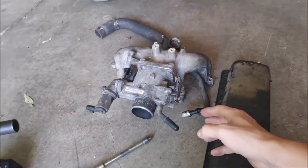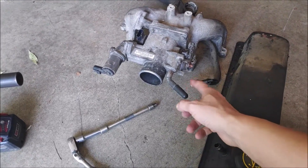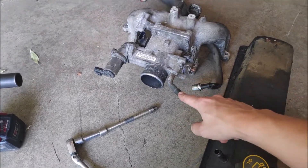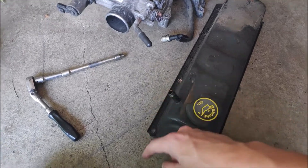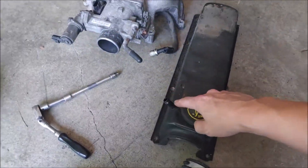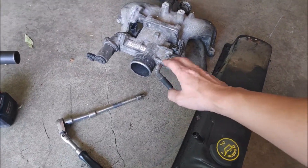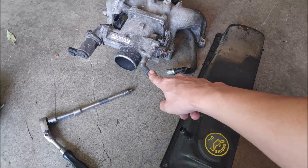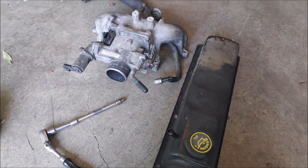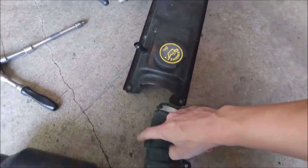Next, you have to figure out how to run your throttle body. You can keep the original 2.5 liter intake or swap to a 2.3 liter intake and throttle body. The main difference is the throttle body. On the 2.3 liter, this tube is blocked off because the hose from the valve cover goes straight to the intake tube, while on the 2.5 liter it goes from the valve cover to the throttle body. I've decided to keep the 2.5 liter intake and just block off this outlet and run from the valve cover to the intake tube. You can also run it the 2.5 liter style — from valve cover to the throttle body and block off the hole in the intake tube.